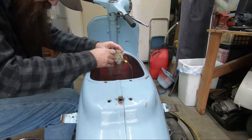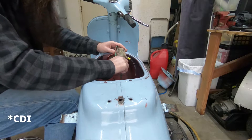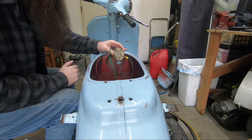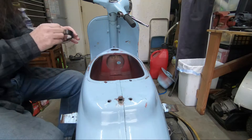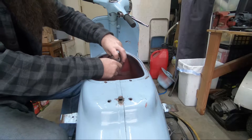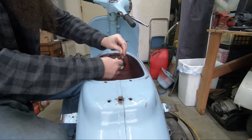As you can see, the switch does absolutely nothing. It's got ground going to it, which it doesn't need, and it's got the green wire from the stator connecting straight to the wire going to the regulator. So this is pretty much worthless — they just jerry-rigged it so it'll run. Since that ground wire doesn't need to be wired in, I'm just going to tape it off. I'm going to rewire the whole thing later on. I just wanted to make sure it would run before I start playing around with the electrical system.